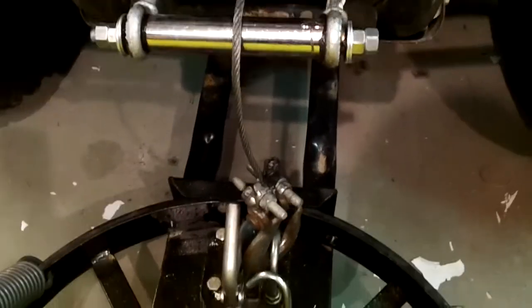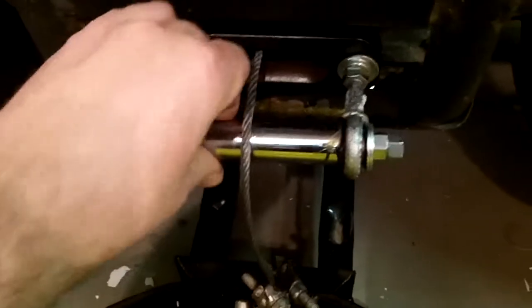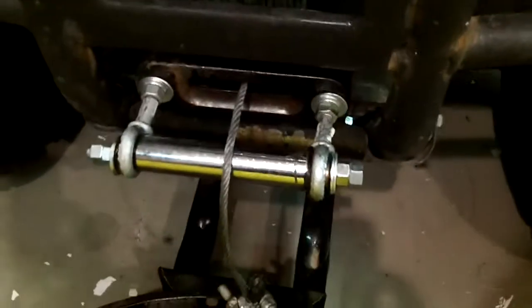Inside of that is actually a piece of conduit, and then a piece of threaded rod, which should have been bigger, but I used what I had here. Double nutted, and see this, this will actually turn. The outer turns, the inner turns, and the whole assembly turns. So it seems to do the trick.